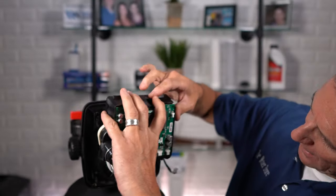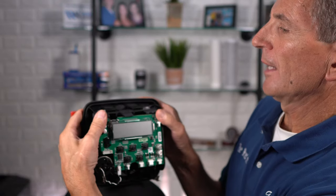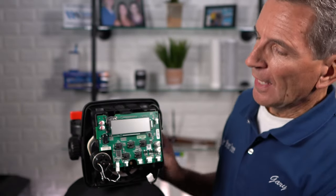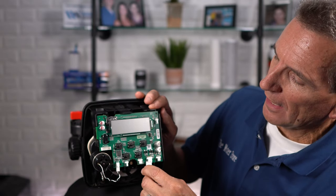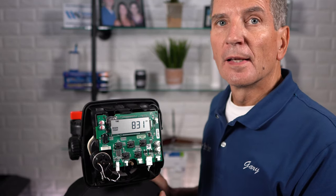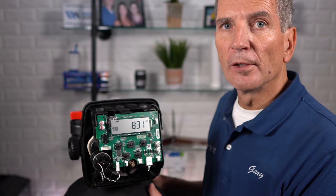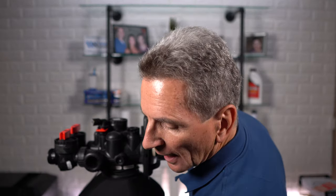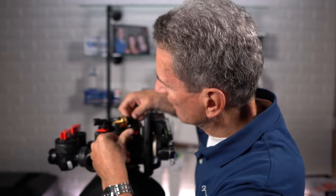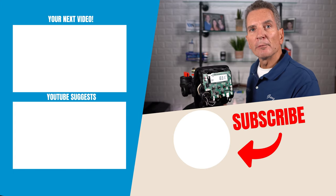The feet clip in on the bottom on both sides. Bring it back and it'll snap into place — make sure it snaps so you know it's seated correctly. Attach the power connector and it'll go through the setup procedure, which takes a few seconds. It's done when it returns to the correct time and you don't hear the motor making noise anymore. Then reconnect the drain line, make sure it's tight, put it back into service, and the trickling and water flowing to the drain will be gone.